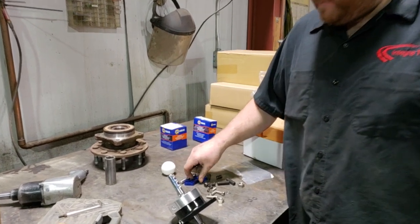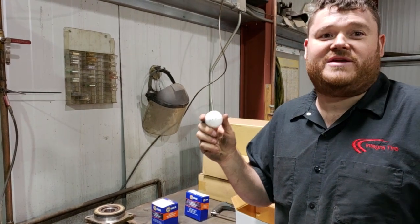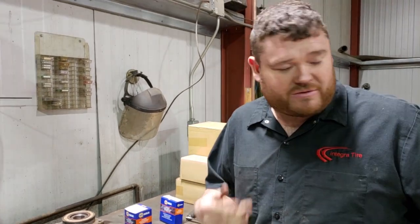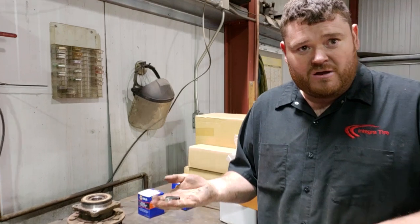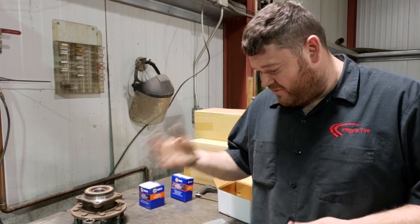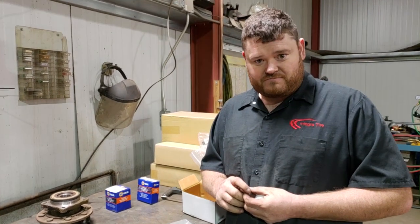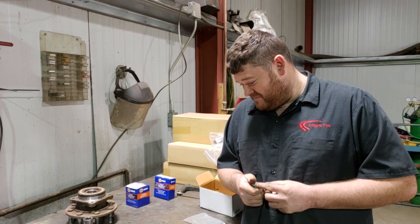If that's all we break, we can always put another handle of better quality onto the shifter base. We also have a quintessential white shift knob. The only thing this kit did not come with is a jam nut for the shift knob, since the factory ones don't need one. You also get jam nuts with your shift detent lockouts so you can adjust travel and make sure you don't over-shift and bend your shift forks. This will fit a T5, T45 — doesn't matter whether it's V6, Cobra, five-liter, or four-banger. If you have a 3650 you'll need a different shift model, but they make an EconoShift for that one as well.